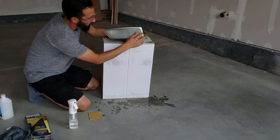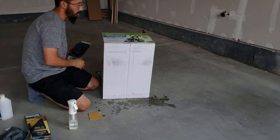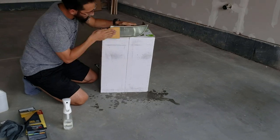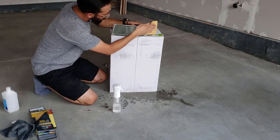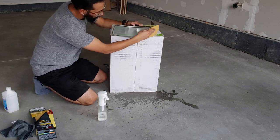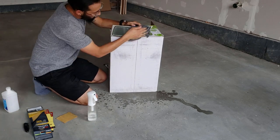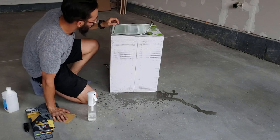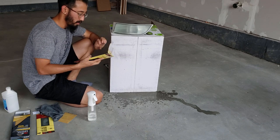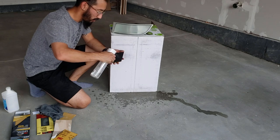It's just going to have a uniform cloudy finish. What I like to do is use the same grit on both at the same time, that way I know I'm not skipping a step. Once you get both headlights done with 400, we're going to move on to 800 — just use the same technique, medium to light pressure, wet sanding back and forth.